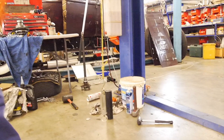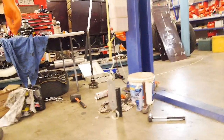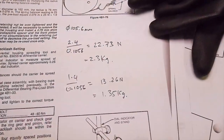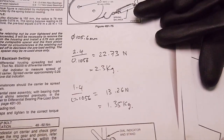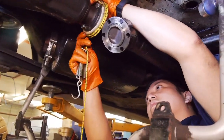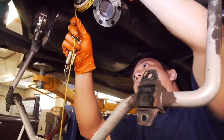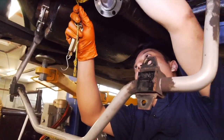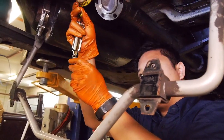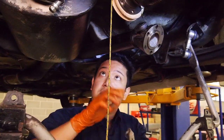Just a fraction tighter - it's about one kilo. And according to the spec, it's 1.35 to 2.3 - that's what you want. Just over two kilos. Triple check - 1.35 and 2.2 I think it was. Sounds about right. Pinion's done. Check the backlash of the diff center - we'll put the center back in. We'll stake over that nut so it doesn't move and put a paint mark on there so we know if it's ever moved in service and where to put it back to.